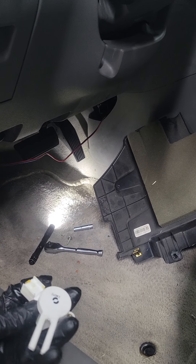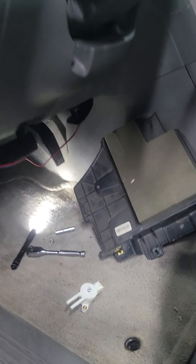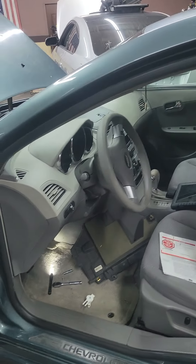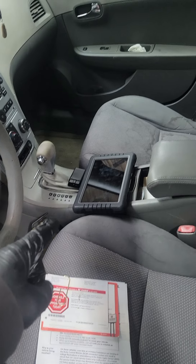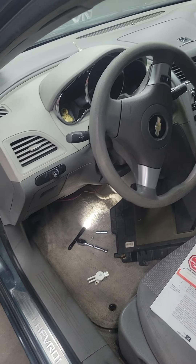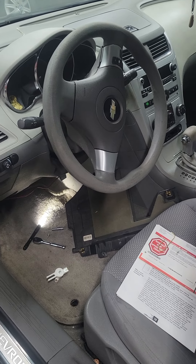Anyway, that was a quick guide on the Chevy Malibu, Cruze, and Sonic — they all have the same problem with the brake pedal switch sensor. I hope this video gives you a guideline on how to replace it and how to recalibrate it. You need to use a scanner — go to automatic search, find the VIN number, go to special functions, and it will give you the option to recalibrate the brake pedal switch.